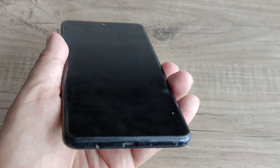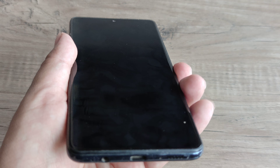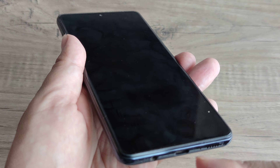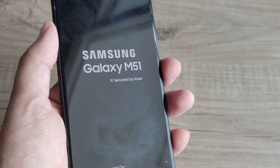Before I forget — one of the most common things many people face is that the phone itself isn't charged. Go ahead and charge the phone for some time to give it some juice. Once the phone has at least around five to six percent battery, then do the volume down and power button together until you see the Samsung logo, and the phone should be just fine.